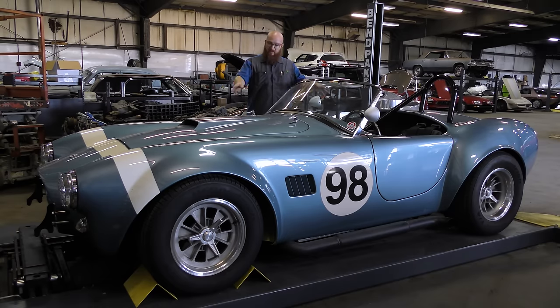We've talked about and seen the differences between the Superformance and the Factory 5 Cobra, but we haven't fully answered why it's here. The concerns were the odometer not working, having fluids checked out, and a general checkover of the entire vehicle. Also, it had been sitting a while, and when the customer tried to start it, there were very long cranking times. Rather than damage anything, he brought it to The Wizard. Luckily, nothing was wrong — it just needed to be primed to get the fuel system primed. The reason is it has a mechanical fuel pump, so if you just turn the key on, nothing primes; you have to crank and crank. Once primed, it started right up.